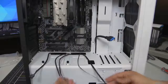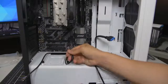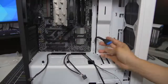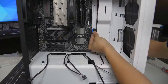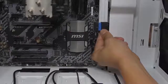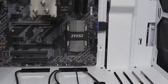I've already routed all of my front panel connectors through the various cutouts in the case strategically — I routed each cable through the cutout closest to its appropriate header, which is why the HD audio connector is right next to the HD audio header on the motherboard, and the USB 3.0 connector is right next to the USB 3 header. I'm going to start with the USB 3.0. All of these except for the really tiny connectors are keyed, so make sure you're plugging them in the right way or you'll break some pins. I have broken many a USB 3.0 pin before — there we go, USB 3 is secured.